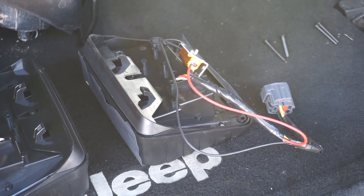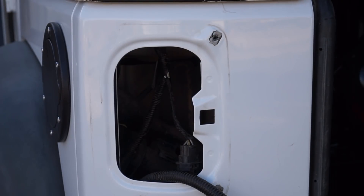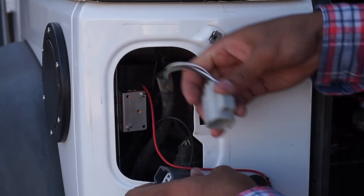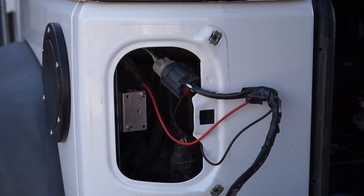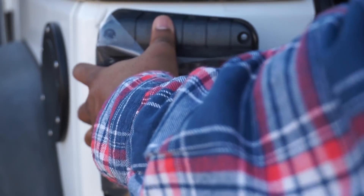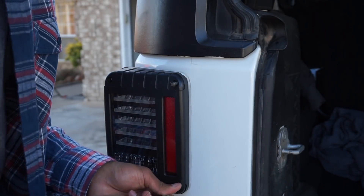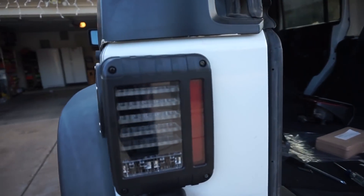The wires are all electrical taped up, looks real good. Now it's the fun part — install. The left one here, we're going to go ahead and slip in the resistor piece, kind of right there, and then connect up the wire. Easy — snap, wait for that click, and give it a pull to make sure it's secured in there. Feed all the wire through, make sure it seats properly. I had to give the lights a little bit of gentle persuasion to make sure it clicks into place. Step back, make sure everything is straight, then go ahead and get those screws and tighten it down.